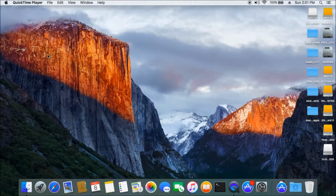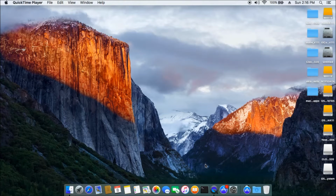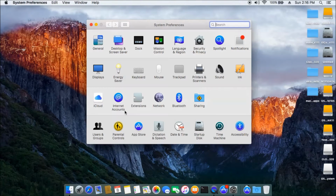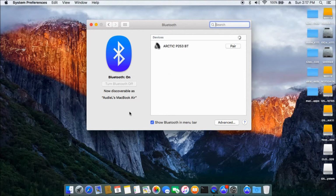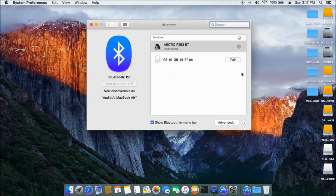Okay, so after patching Apple HDA and loading the patch from RehabMan, the SSDT, the battery worked, Wi-Fi worked, the sound worked. After we patched the USB port, our Bluetooth came out. Oh, here it is. All right, the Bluetooth works. Pair it. Is that the mouse? Yeah.